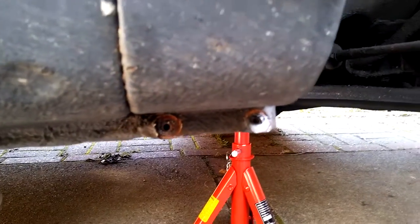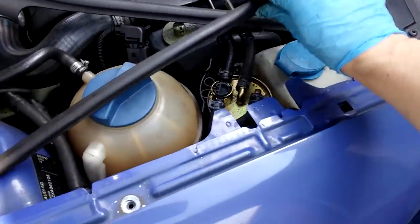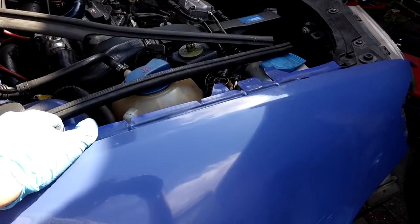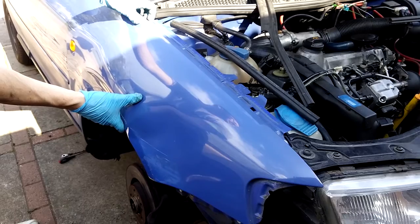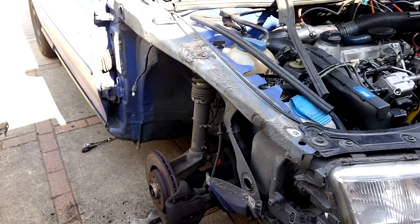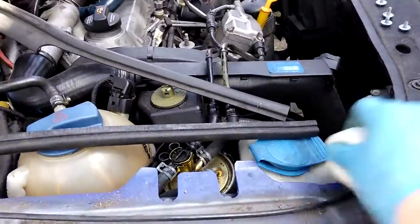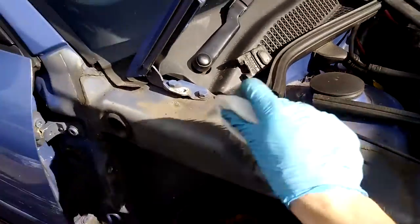Now the wing should be ready to come off, but you might need to give it a bit of a tug — take off this sealing strip as well — because it will have been glued to the bodywork. Once it's loosened up we're just going to pull that off and take it to one side. Watching the bottom as I give it a shake you can see all the dirt that comes loose. If you've seen the other video where I prepped the wing, the new wing I got had some rust in that area, so you're going to want to clean up any new wing and make sure it's protected down there.